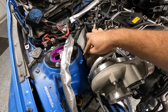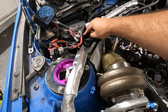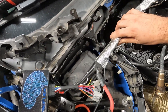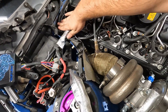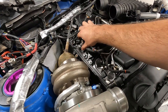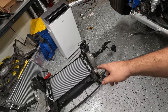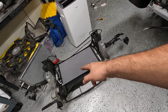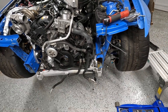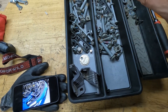Got the auto line sorted out — this is usually the line that wraps all across here. Took that apart a little bit, put some heat wrap on it, made a little heat shield, and for this main power line and another power line up here I cut a little indentation in there so it'll sit in there. There's a cover all along here but to have it that close to the downpipe is just not a good option. Other than that, pulled everything out to get ready to crank it. I think I'm going to go ahead and put the whole radiator support and new AC condenser on so I can have it there and still have room to check everything out.